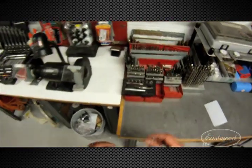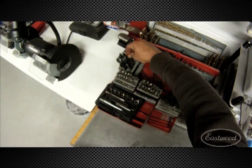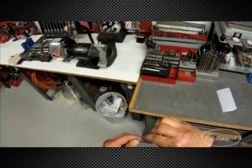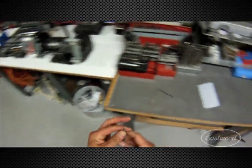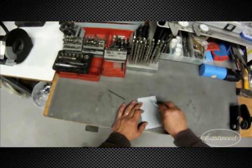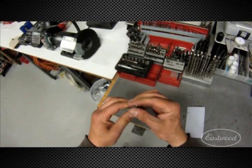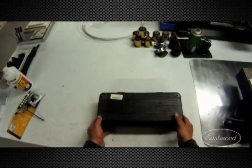Here's a tip: never just start flaring right after cutting. Get yourself a drill bit of the same diameter — this is 3/16 we're using — just run it around in there a couple of turns. What that'll do is take that burr right off so now you've got full fluid flow. Then take some sandpaper and just walk it across; that breaks the sharp outer edge so now you've got perfect ID and OD.